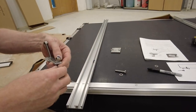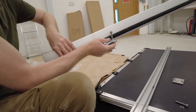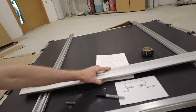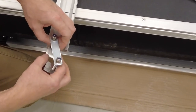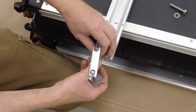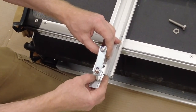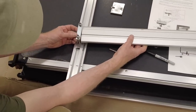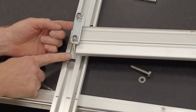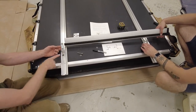Let's show how it clamps on the car. This is the crossbar on our roof. The tricky little system mounts like this — you get the nut in the right place, it points around. But they haven't made it wide enough for the Land Rover aero bar, so we're going to have to make up some new wider metal straps with the correct spacing.